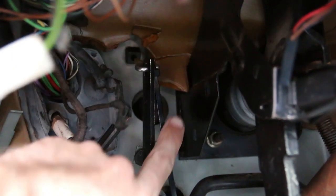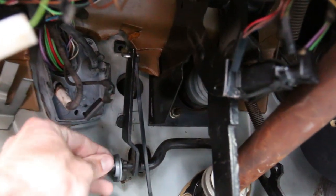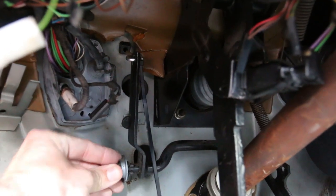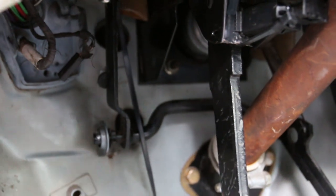So if you guys can see right up here, I actually have a zip tie holding in my accelerator cable right now. I replaced the cable because that was stretching out with only like two little frayed wires left. But these bushings have always been missing too. There's supposed to be a grommet or bushing here - see how much play there is? That's not supposed to be like that. So we're going to replace those.